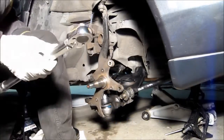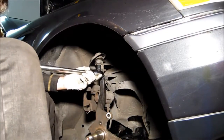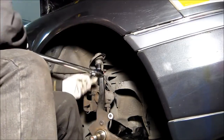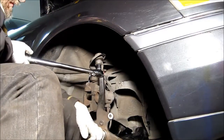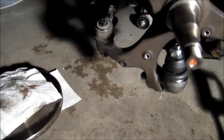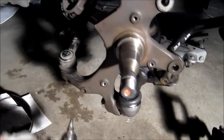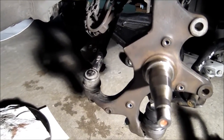Okay, this one works out to 45 Newton meters for this nut — that's about 35 foot-pounds. So I'm just going to put this steering arm in. This joint is 50 Newton meters, so that's somewhere between 35 and 40 foot-pounds. You need to hold it on the bottom initially with an M5 otherwise the pin is spinning — so you hold that, you tighten, then you torque it to 50 Newton meters and you're done.